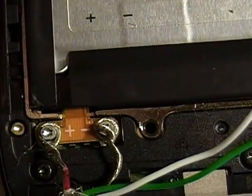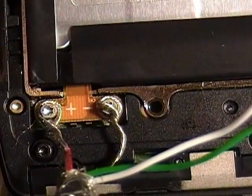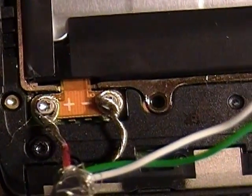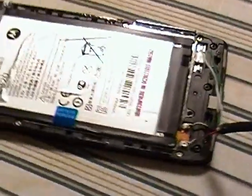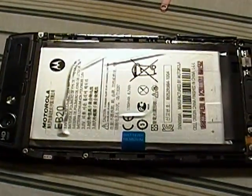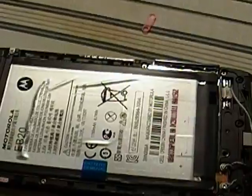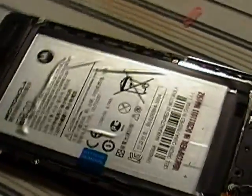You'll see one's positive, one's negative. The red goes to the positive, the black's going to go to the negative. What this does is it allows you to charge your phone when it's in a mode where — if it's boot looped and you can't get it to turn on — the software won't recognize your charger. This way, it'll charge your phone and you'll be able to get it to where you can fast boot it. So this is part one — this is what we're doing just to be able to get the phone going.